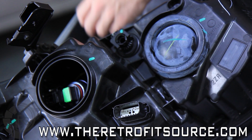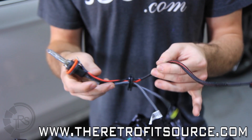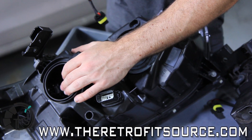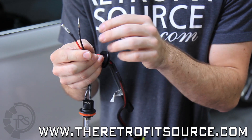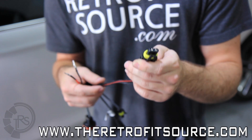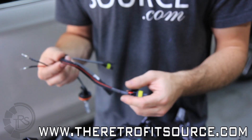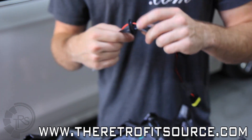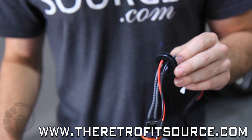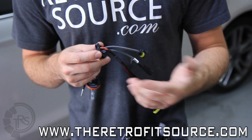This is not what we're working on today — we're working on a car that has the sealed cap. In this case you actually need to modify the cap so the wiring for your bulb can come through it. The connector that goes to the back of your halogen bulb will connect to the pins on the end of this wire, and you'll pass this through to the back of the housing. Ultimately this will end up plugged into the input on your relay harness on one side, or the standalone CAN bus harnesses on both sides of the car. You'll need to drill a 7/8 inch hole in the cap so the rubber grommet can fit through and reseal the headlight perfectly. We'll go ahead and modify that cap, get our pass-through installed, then install the CAN bus harnesses and ballast and put it all back together.